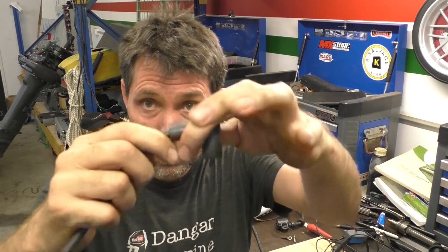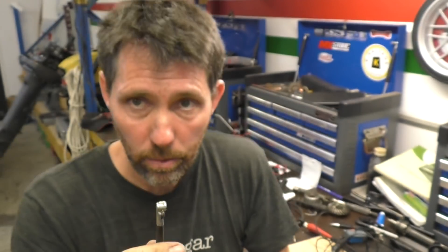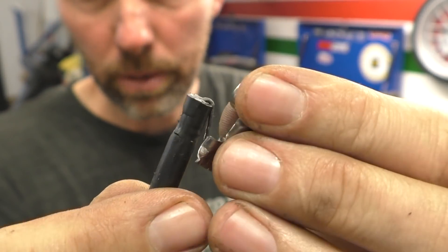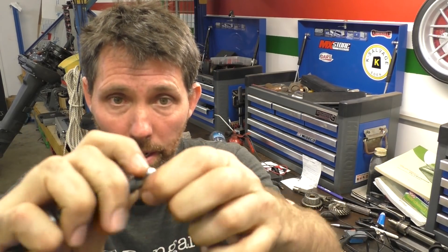Another common type you'll see is where you take the spark plug out and just pull the rubber boot off the end. You can see it's not a spring this time, but it's a similar idea — it's crimped onto the wire. If you pull that crimp off, you can see the core is just folded back and then pressed against there and crimped over. It's a pretty simple connection, and because it's a really high voltage, having it pressed up against the metal is more than enough to have the current flow through. When you buy those, they come sort of ready to crimp on — this one is actually an internal fitting spring, designed to go at the distributor end, but same idea. Fundamentally they're pretty robust. If you had an HT lead and you wrapped the wire around the end of a spark plug, it'd work — it's not going to work reliably with vibration, but they are actually a pretty robust connection.